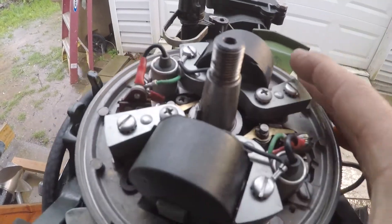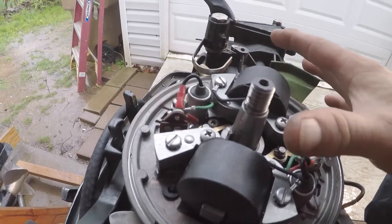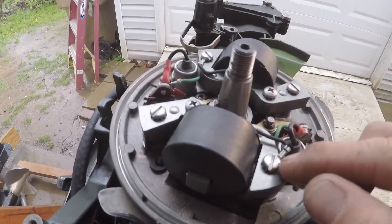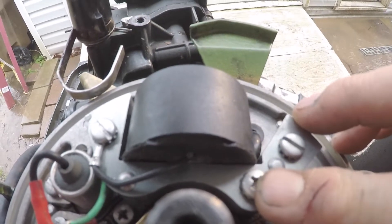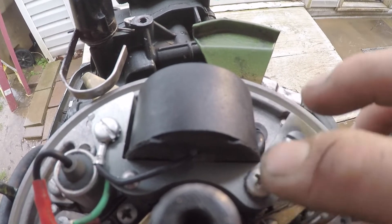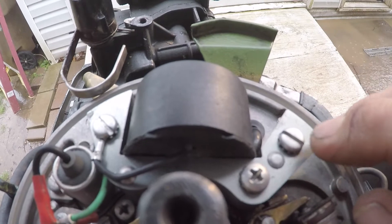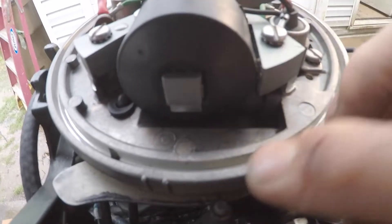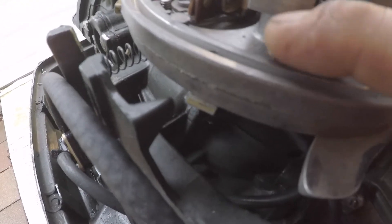I videoed this rebuild and got it all installed — it's raining but still working. So if you look, this is your coil, you got a ground wire that's gonna go to chassis. You want to make sure the water goes out of the way. Over here you got your Phillips head that secures the coil to the plate, and then you got your other screw — these are adjusting screws for the front. You want to make these as flush as possible, and you can do this with just your fingers and thumb.